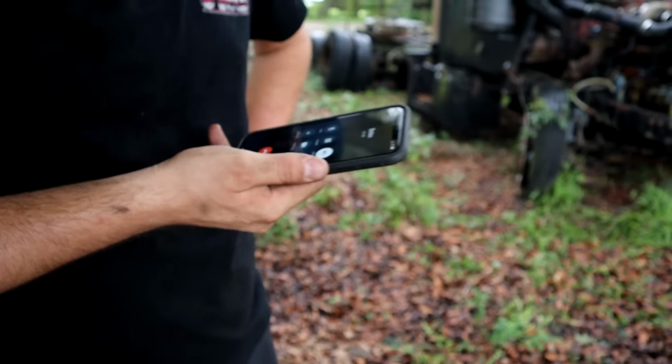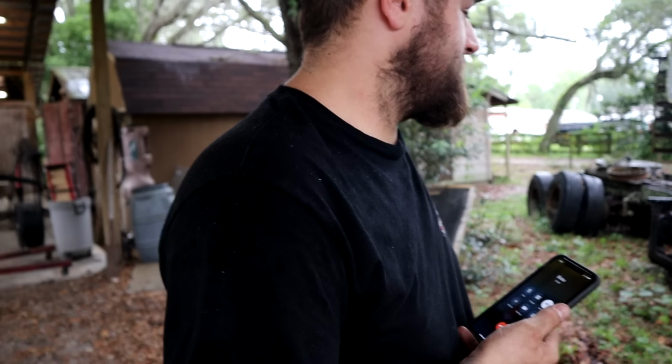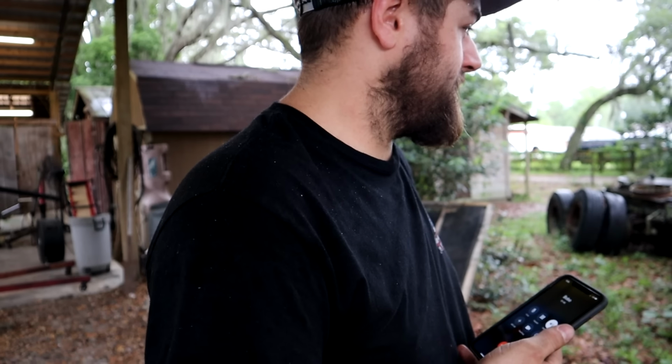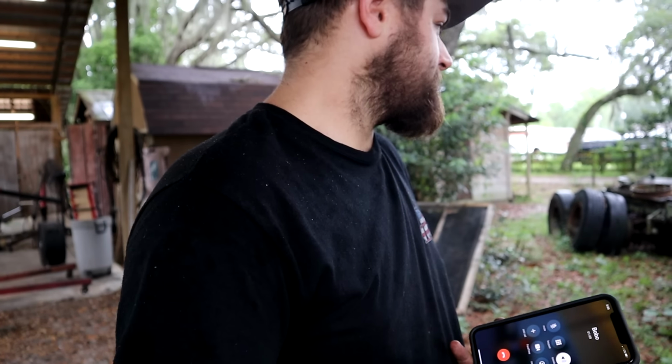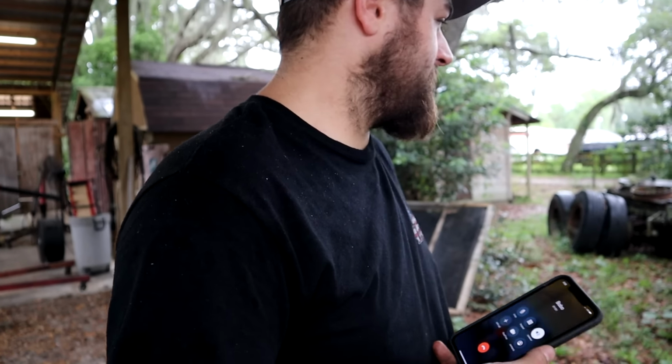Mm-hmm. Well, we're cleaning up now. I left you some new battery terminals on it. All the fuel's coming out, all the injection pump, all of them but number 6. So it's gonna have to be rebuilt no matter what. Oh yeah, okay. But it's all cleaned up and buttoned up and sealed back up the way it was. Maybe you can make some money off of it, but it'll crank up and run on the idle.